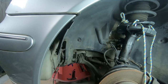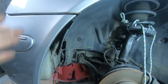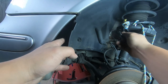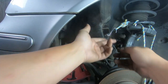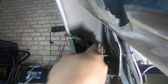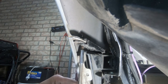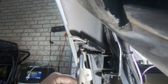We'll now remove the bracket that holds the front bar to the side fender. In order to do this, what I like to do to make life easier is I just use a piece of rope and a hook, and I just hook it on the hole here just to get it out of the way so we have room to look underneath and remove that bracket. There is a black piece that is a bracket that clamps the front bar and the fender together. You have to remove a T25 Torx screw right here so that you can remove the bracket.